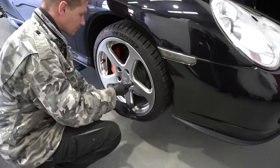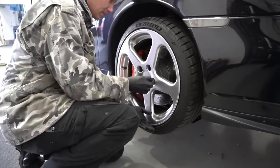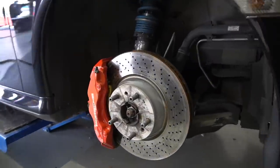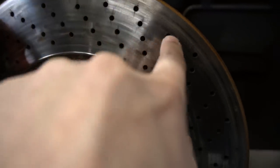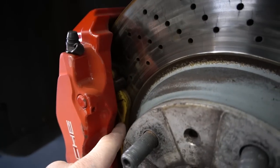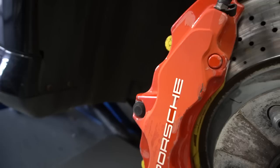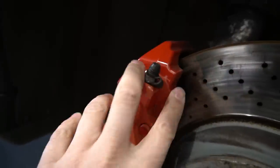Martin's got the first wheel off — let's look underneath and see what's happening. I know not a lot of people love the 996 but it's one of my favorite things ever. These brakes — you can see they're all cracked. This thing's been tracked pretty well its whole life. I don't know what kind of brake pads those are but they are aftermarket brake pads. Look how hot these calipers have gotten — even the clear coat is faded. Those are going to have to be refinished.